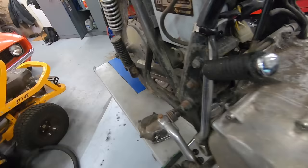This is what goes straight through the oil filter. Caused low oil pressure on his ride home. He didn't have an oil pressure switch to warn him of that. Continued riding with little to no oil pressure, locked up the engine, then of course parked it with no spark plugs, which caused all this problem. But that all makes sense in my mind, so I think we may have just cracked the case on what killed this engine originally.